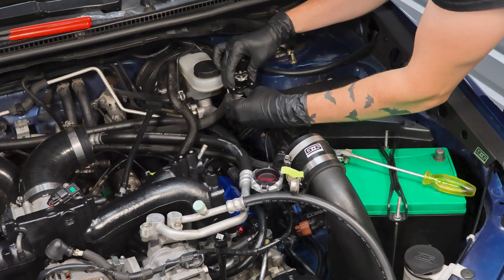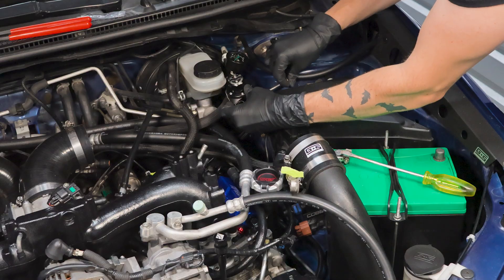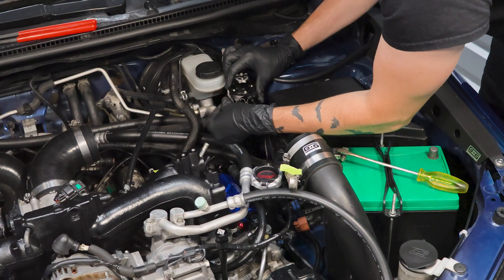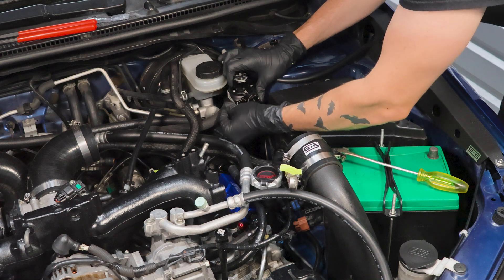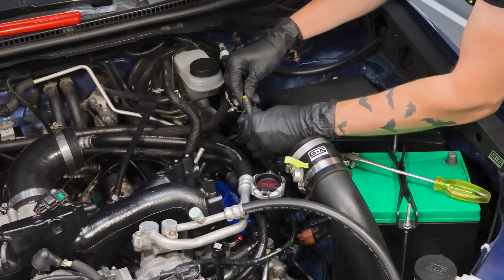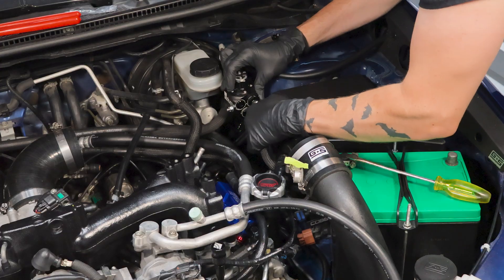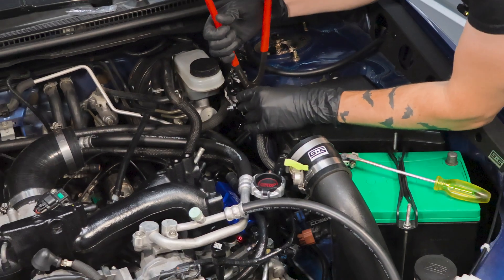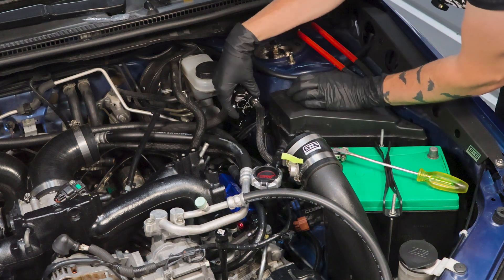Now for the bracket — I think I'm going to utilize the first mounting point. We're going to grab our M6 bolt and washer, which they supply in the kit in a little baggie. We'll slide this through, grab the M6 nut and go on the bolt, slide that through, and tighten it down. We're just going to mock everything up first. The return for the flex fuel kit is right here — it's got to find the actual line. We're going to slide a crimping clamp over this, then slide this through. Hopefully everything's oriented correctly because I'm going to crimp this down and don't want to do double work. Now grab an Allen key and some type of wrench, secure both sides while I tighten one side — and that's pretty much it.